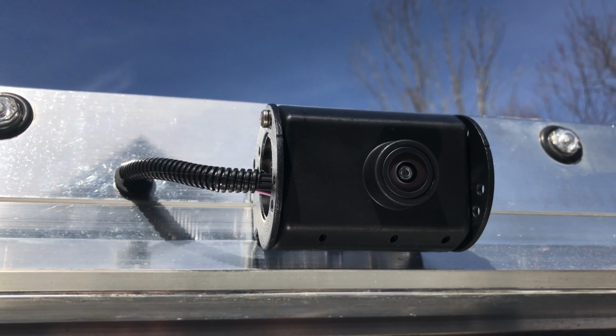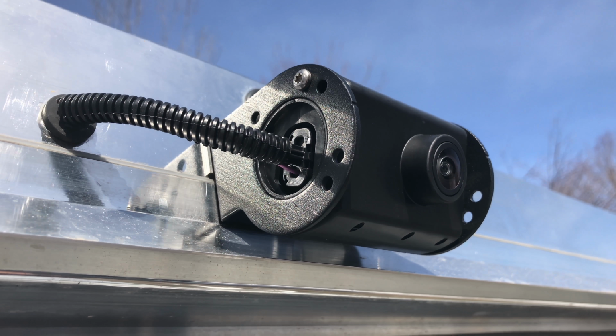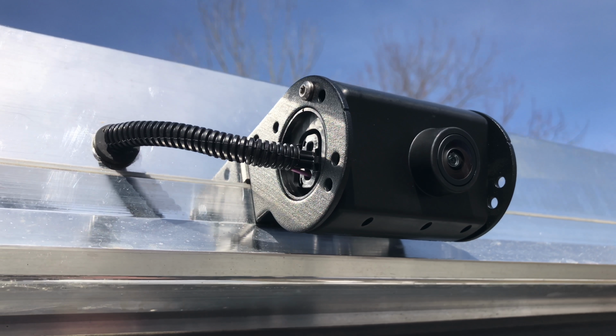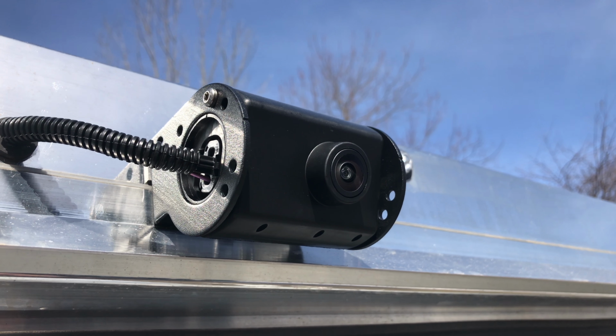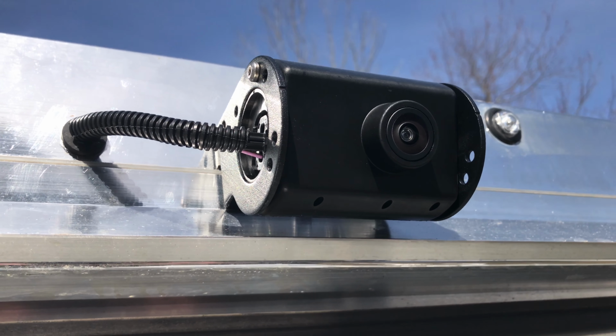of the trailer. I actually removed the connector from the end of the cord, noting the pin out, so that way I could rebuild it and keep the hole through the back of the truck as small as possible. Just be careful when pulling apart that connector. There's a lot of small parts that can easily break, especially in cold weather, as I found out.